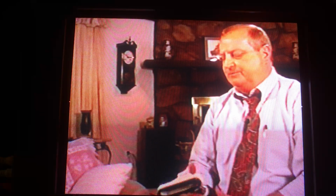Another thing you can do with this tool, Lisa, is you can clean your drapes and your drapery and your curtains. For example, when you cut this on, go over there to those drapes, and just put your hand behind the drape and pull this down the drape. And then on the lighter curtains like you have in the kitchen over there, what you could do is open this bleed valve up here. That would cut your intake of air. And then at the same time, you could put this on low, and that way you don't pull as much air and it won't pull those light curtains in.